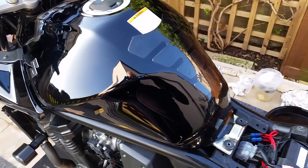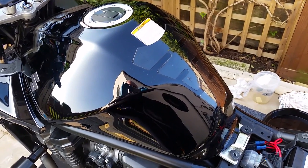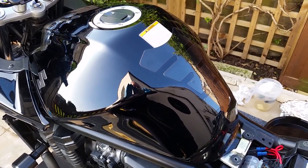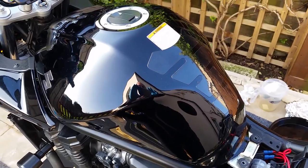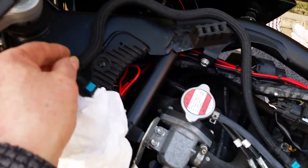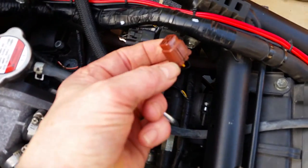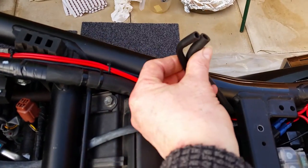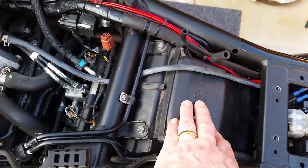Alright, next job — I want to change the air filter and the spark plugs. So we've got to start by getting the petrol tank off. It's simply a case of undoing those two bolts you can see on the bottom right-hand end of the tank. We'll disconnect all the connections underneath the tank and then take it off. There's your fuel tank removed. There's your fuel hose that clips on the bottom of the pump, there's your connector that goes to the pump as well, and there are your two overflow pipes. Once you've disconnected all of them your tank's free to lift off and give you access to this area where you want to change your air filter.